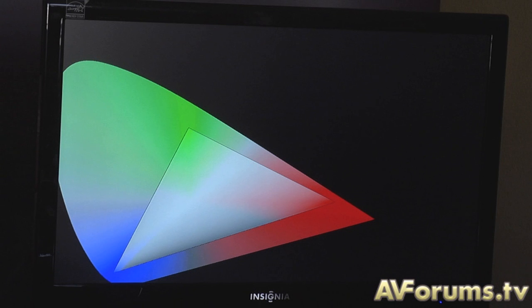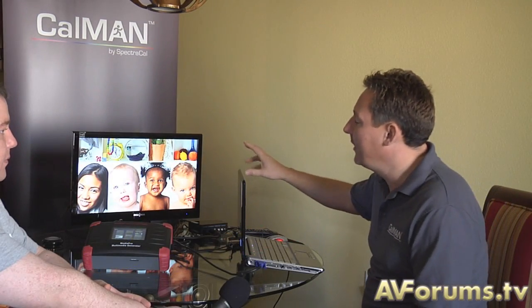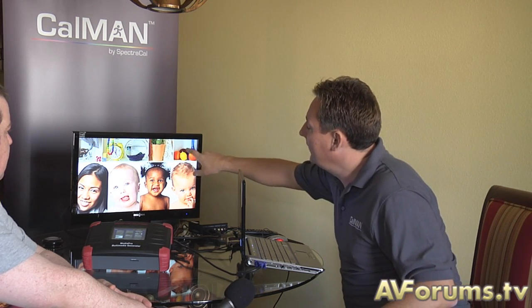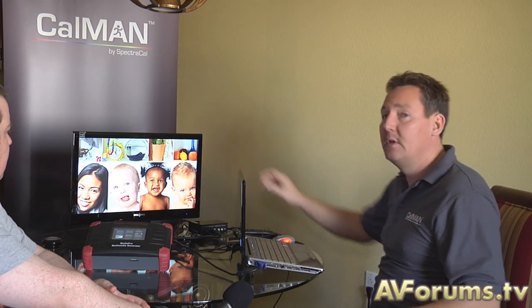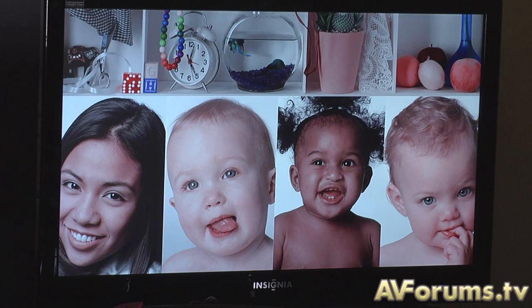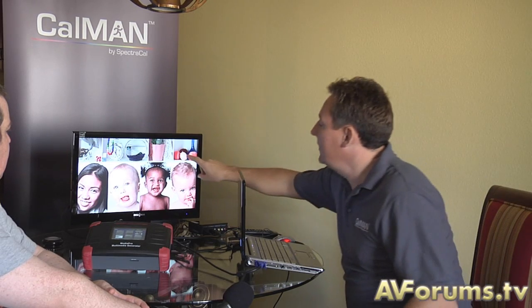Another example we've been showing is how much control we have over live pictures. We've switched to a pattern that shows a demonstration of material you would normally be looking at. Traditionally we've looked at flesh tones to try to determine how to calibrate a display, but those aren't necessarily a good indication. One example here: we've got a lemon and a yellow clock. I can go in and change this picture and take all of the yellow out of it completely. Here I've removed yellow from the entire picture, and it really didn't change the skin or flesh tones that much. With the signal processing, anything that was yellow is currently white.